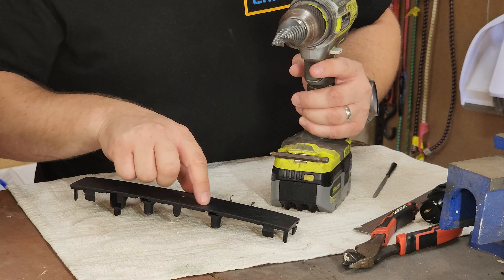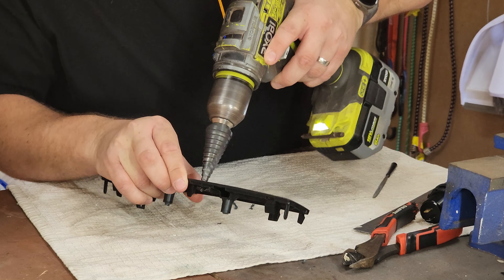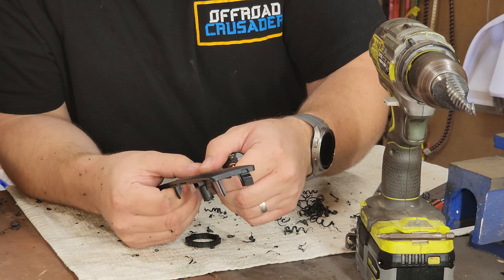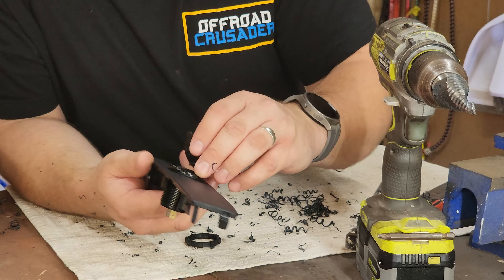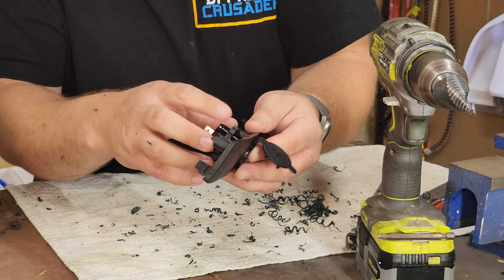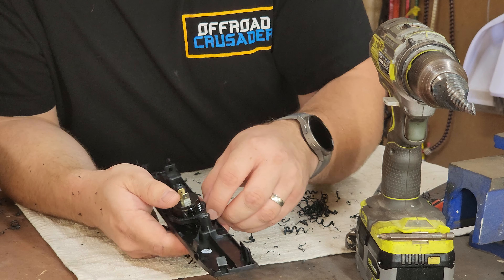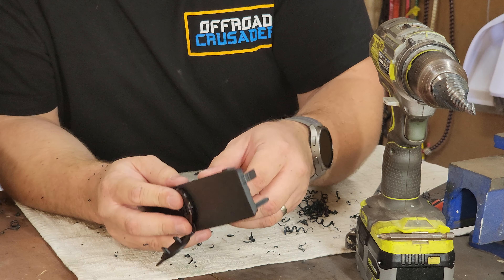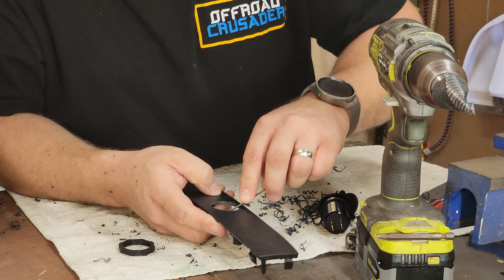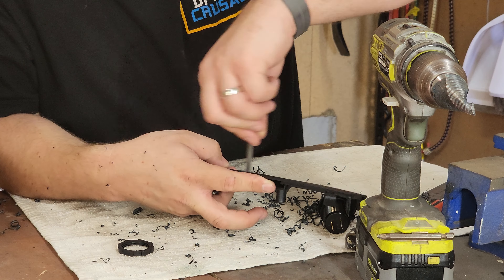Because this is a step drill bit, it will actually round the outside edge really nicely. So I have actually drilled that out to 30mm in diameter. I can now check that this fits quite snug in there and I'm quite happy with that fit. I know that when that's on there, I'm going to put this locking collar on the back — it does have a screw that will come down and lock that in place. You may need to remove some extra plastic off the back there. This locating thing is going to have to be trimmed a little bit around the bottom and then that nut will come down and lock it in place. I am also going to use a little round edge file just on the outside here, just to help clean up some of these edges and make it a little bit nicer. It does just help to neaten everything up and make the job look a little bit more professional.